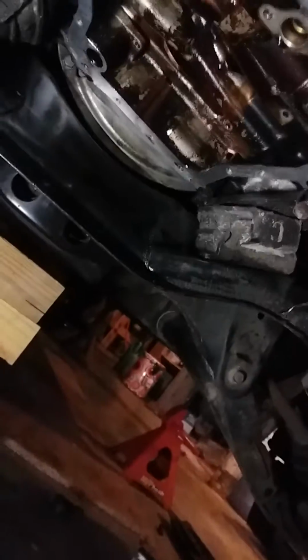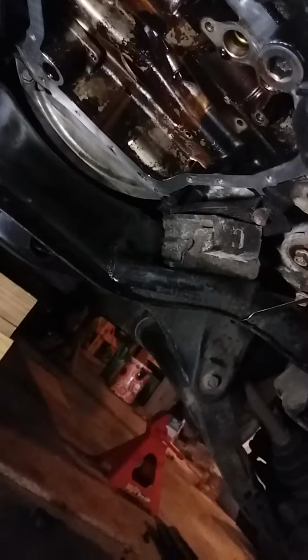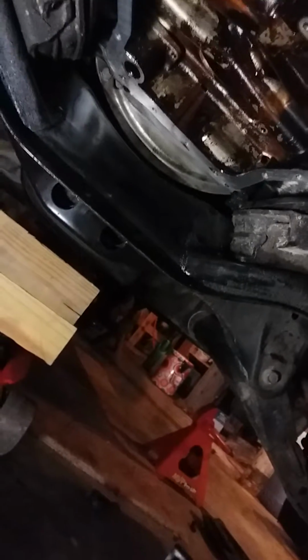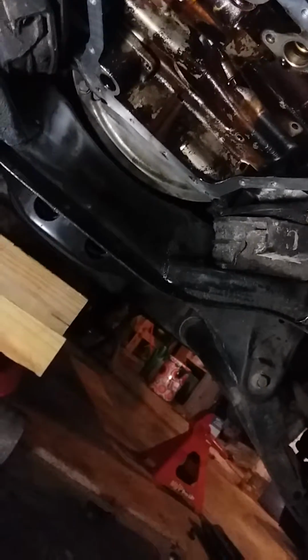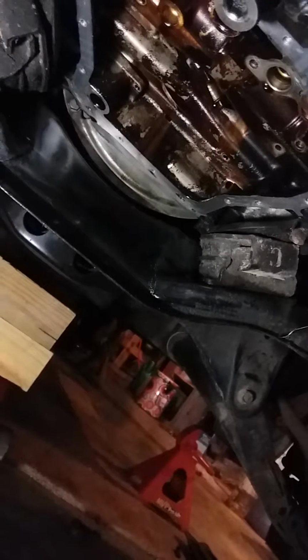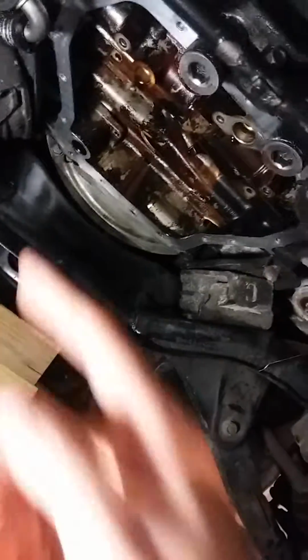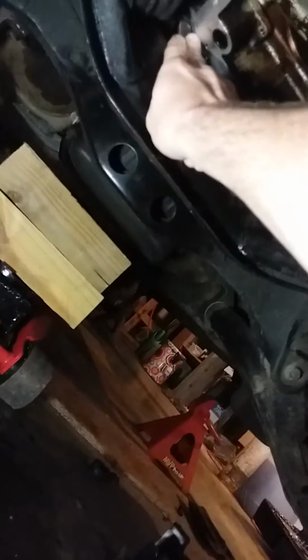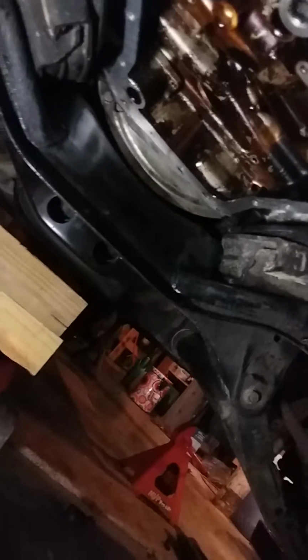For the last 6, I used a 3/8 drive ratchet, a wobble extension, which wobbles at the end and is rounded a little bit, so it allows your socket to move a little. Then I put a reducer to a 1/4 inch on that, a U-joint, and then a long or deep well 10mm 1/4 inch socket to get the last few. I found that the 3/8 socket was a little bit too thick between the outer part of the oil pan that was still there and the bolt. I couldn't get it to bite, so I had to switch to a 1/4 inch, and I was finally able to get it.